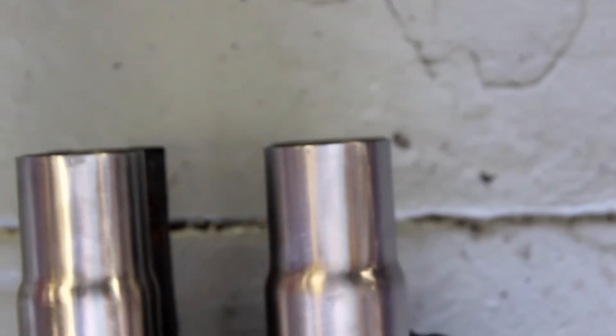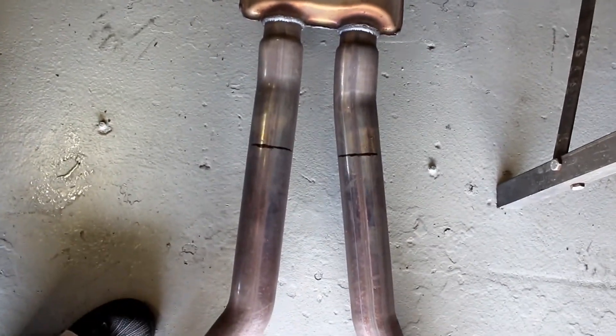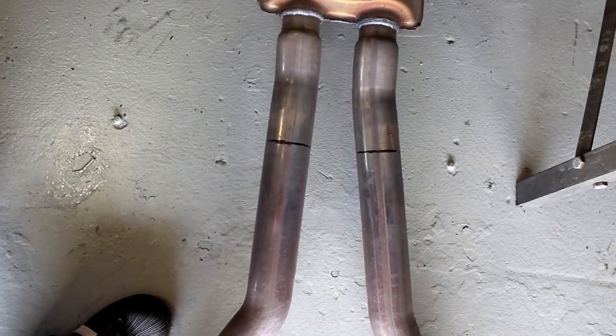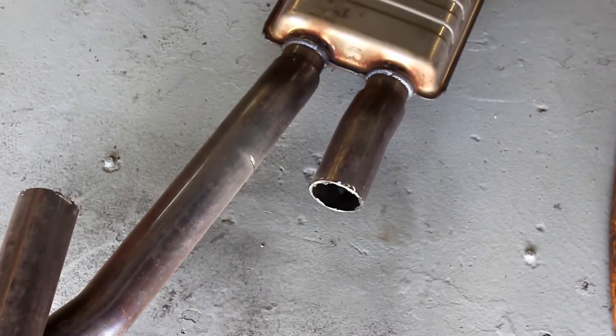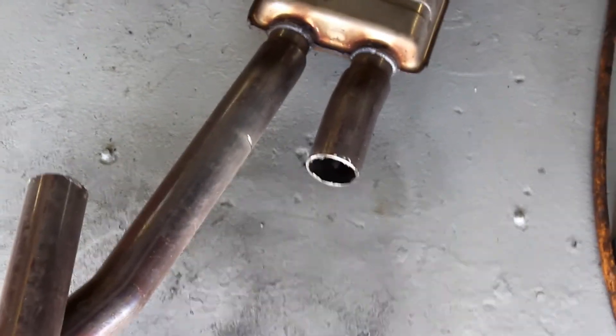Once you get it on the ground, you line up the ends of the exhaust here, then follow it down, line the exhaust here, then take a marker and mark where the pipe ends — that is where you're gonna cut it. Now I have it marked. You can use a sawzall or die grinder, whatever you have, and just cut straight through the pipe, not at an angle. I extremely suggest using a sawzall.